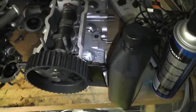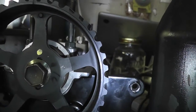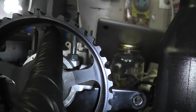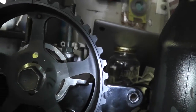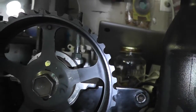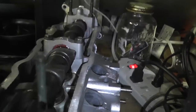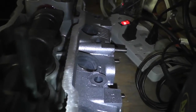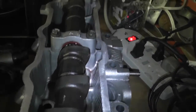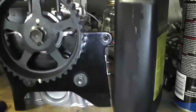We're gonna line this up. If you look at this cam gear — this is the plus-10 one but still the same — it has a dot right here marking where you want it to be. There's also a notch here, but there is a notch down here as well, so beware of that. We're gonna line that up with the mark on the valve cover, straight up and down. This is top dead center for number one cylinder. This cam is flat, this cam is up and to the right, this cam is up and to the left — that's what you aim for. It's okay if it gets turned while cranking to 44 foot-pounds; just make sure you crank it back to where it's supposed to be.